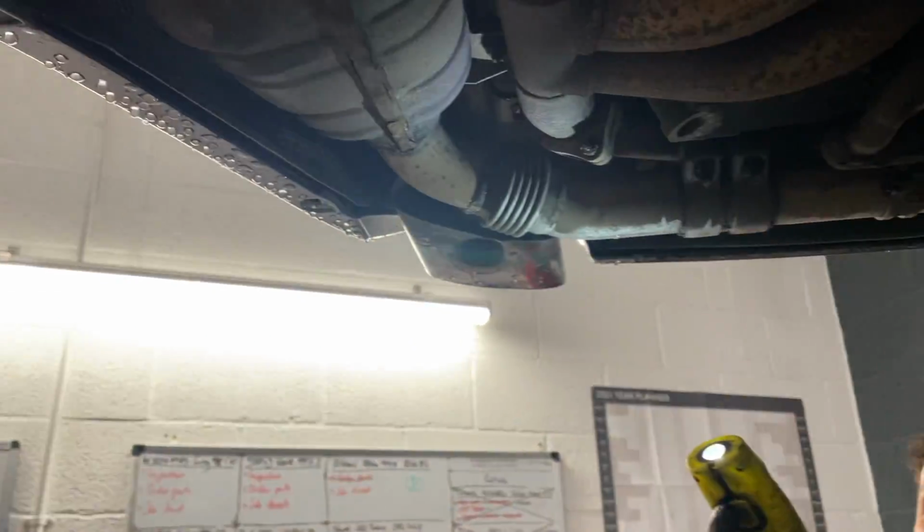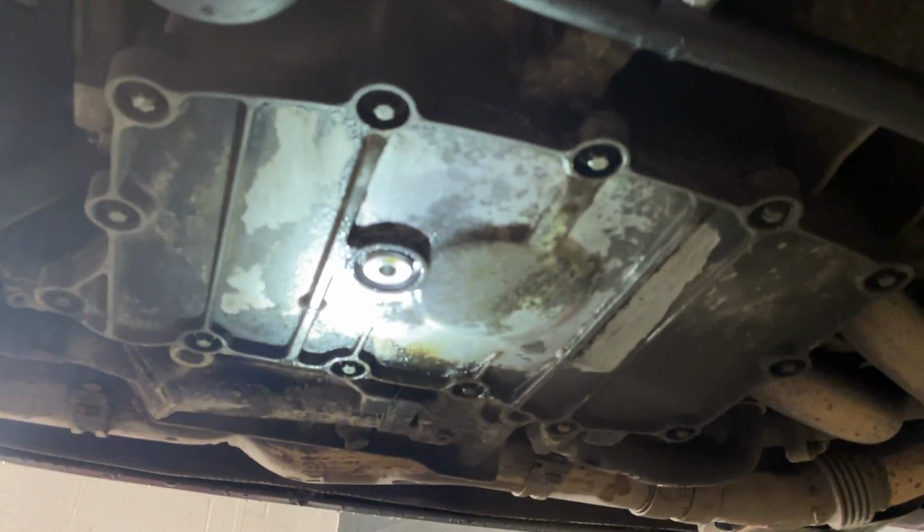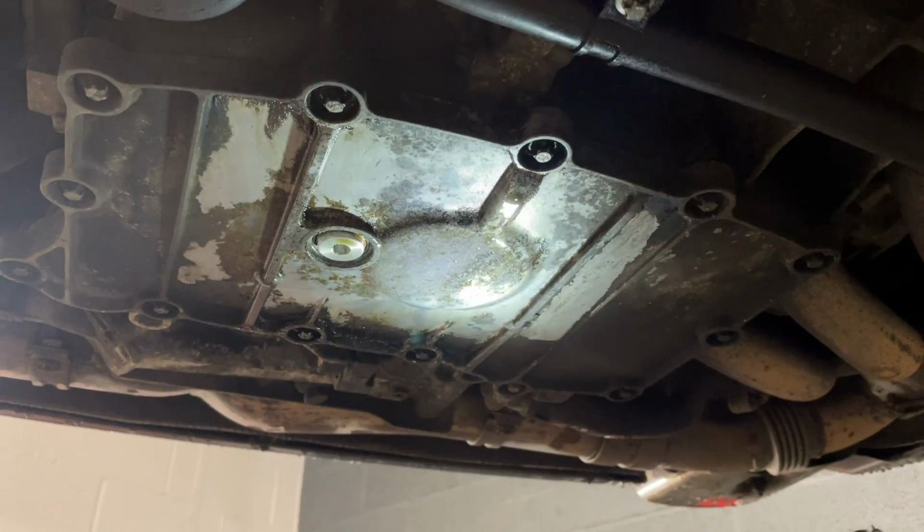You're going to jinx it saying easy and nice to fit now. Yeah. Those fixings on the hangers will all be seized. Usual stuff, really. We've got anything else? We've got a small oil leak here, haven't we? Small oil leak from the sump plug washer there.